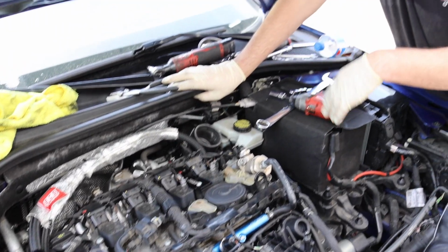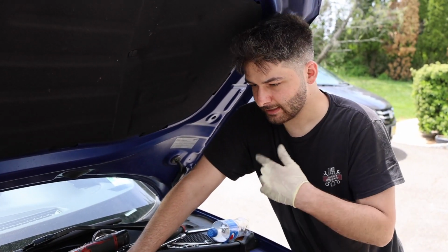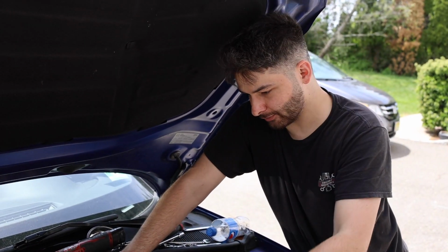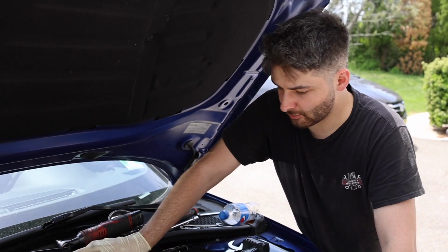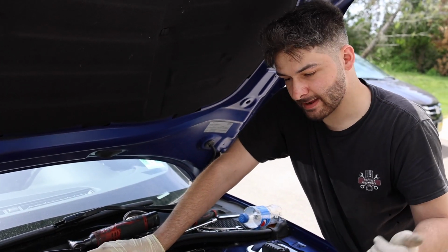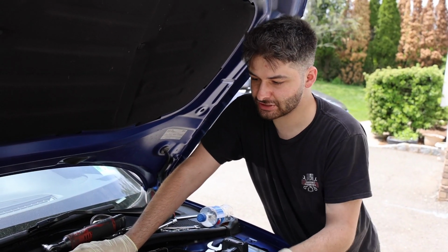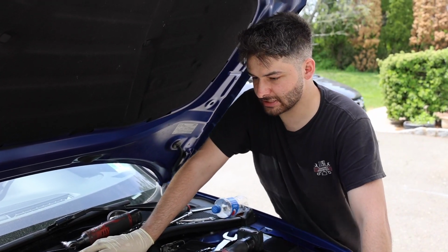But essentially, if you have no issues there and no other issues, you can put the coolant in, get it warmed up, let the thermostat open up so you get the coolant into every little crevice and get all the air pockets out of the way. And then this base map that they provide you with, you could daily drive on it, just don't beat it. And of course send your data logs and revisions to Matt at EQT.